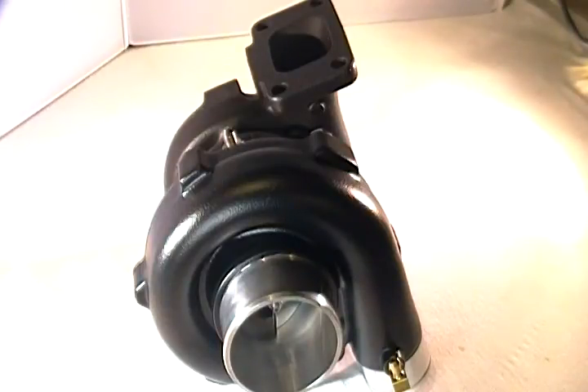The second reason the Predator was developed is because of the GTX 3576R — a well-matched and popular turbocharger released about three years ago, especially for larger four-cylinder inline and boxer four-cylinder engines as well as the six-cylinder class. The GTX 3576R uses the compressor wheel of the GTX 3076R but corrects the mistake of using too small a turbine wheel, swapping the N32 60mm for the N111 68mm turbine wheel shared with the GTX and standard GT35Rs. We wanted to make something with very similar characteristics and response, but easier on the pocket in both journal and ball bearing versions.